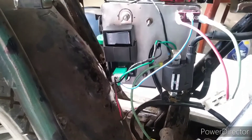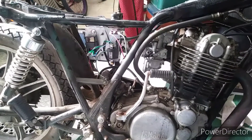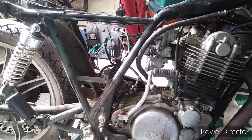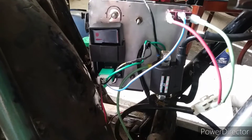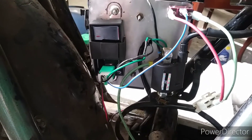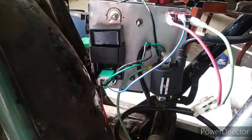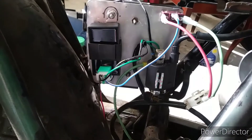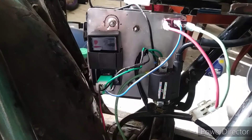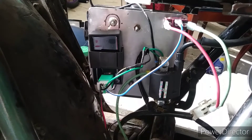Today I'm gonna fool around with this ignition system some more. This is a SR500 that I got with another purchase — it's a parts bike which seemed to have almost all the parts. I was missing the ignition system. These ignition CDIs for the SR500 are really not available anywhere except from Rick's Speed Shop in England. There are used ones available, but they're a crapshoot. So I decided to try one of these GY6 Honda systems — available all over the internet, usually under $20. This one came with the CDI box, the coil, and a little wiring harness that I was able to use for the CDI box.